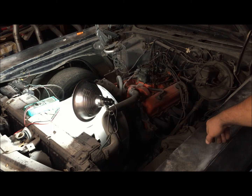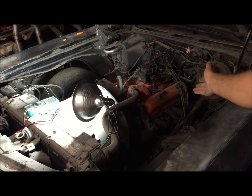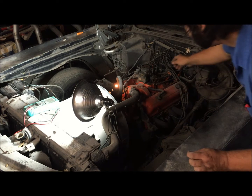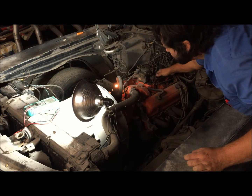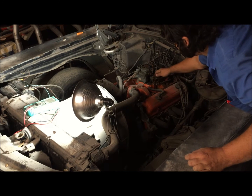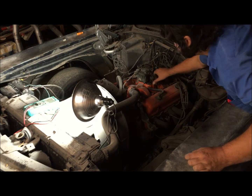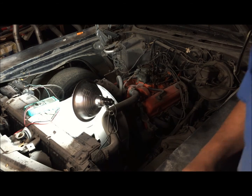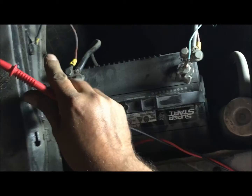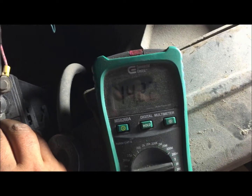See, I have it idled down — the alternator's not spinning fast enough to charge the system, and you can see what happens. We're going to idle it back up slowly and you're going to see the light go off. Always make damn sure that the alternator's charging — I don't care if you bought it brand new. You make damn sure that system is charging.